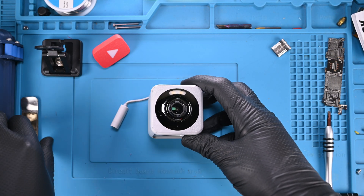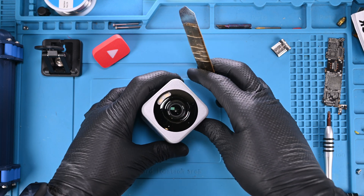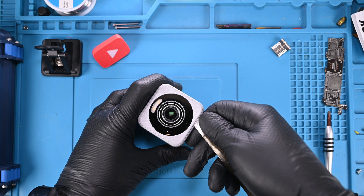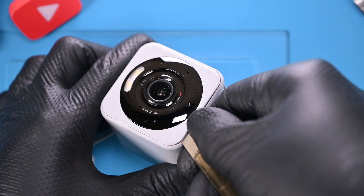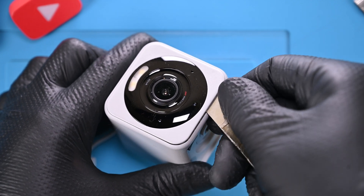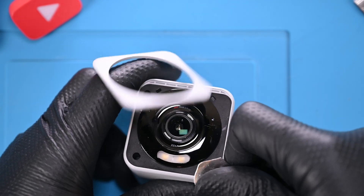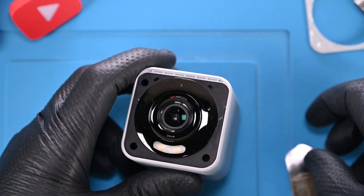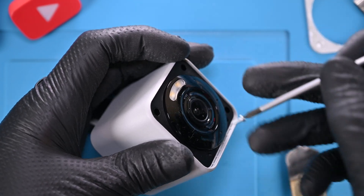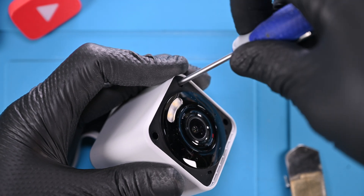That's not why you're here though. You're here because you want to see what's inside — the good stuff, the specifications, the knowledge. I'm assuming this is just like the previous versions where the front cover is a sticker hiding the screws to get inside. Sure enough, the small gap is easy enough for a pry tool to slip under. They are using standard acrylic double-sided tape — good stuff too. After that, we find three aluminum Phillips screws deeply recessed into the frame. Seriously, these go all the way to the back of the housing.